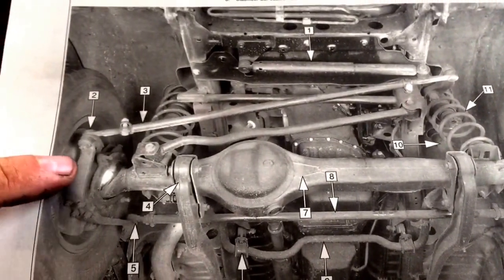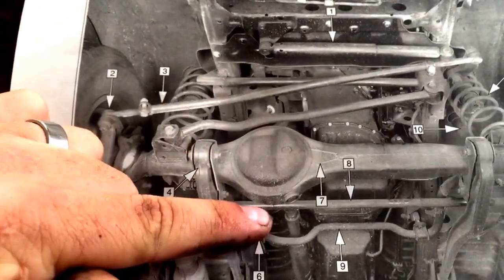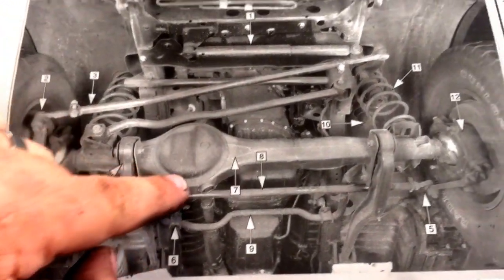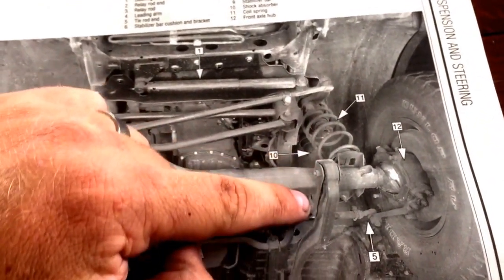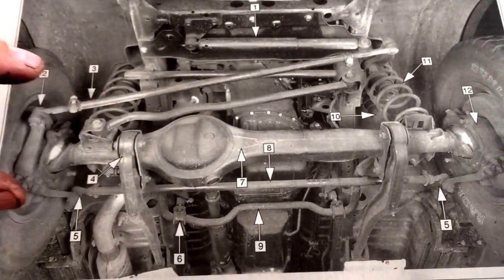And then over the next year or two, I'm going to be rebuilding these knuckles. I'm going to be taking this third member out, putting 529s and an ARB in, which is a high pinion. And then we're going to be, of course, rebuilding this side. And then we're going to be doing caster correction. Caster is the angle in which the top and the lower kingpin align.